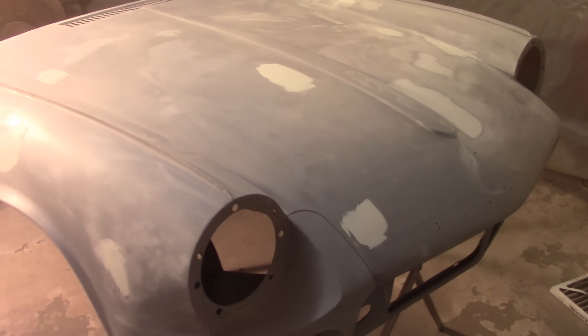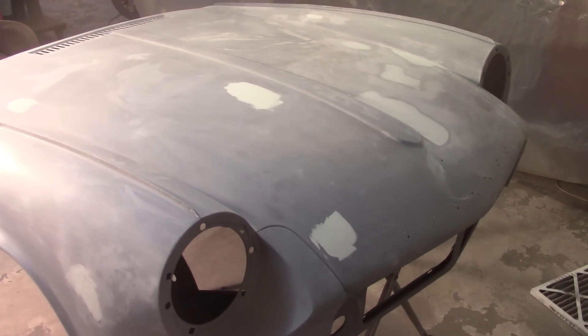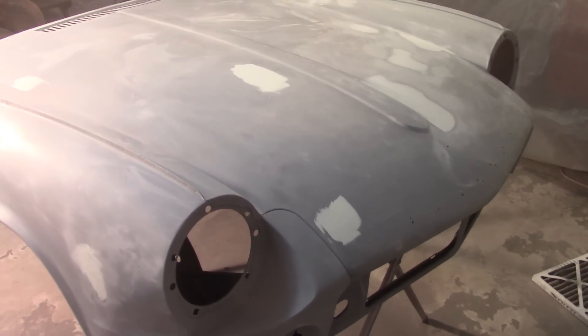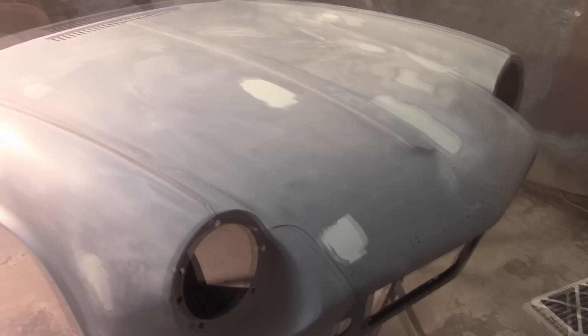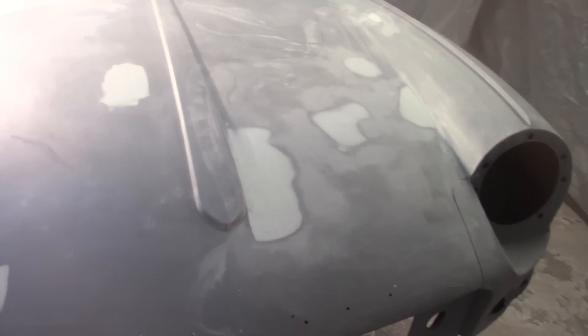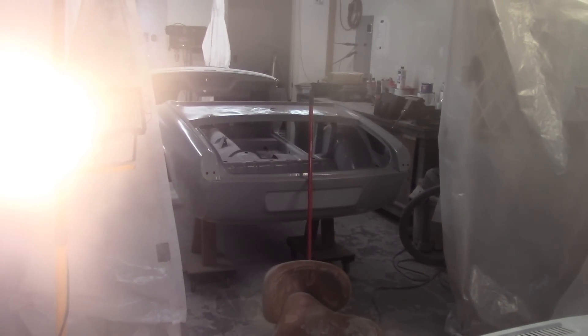Happy Monday everybody, about 3:30, back over to complete hopefully the final sanding work on the bonnet. Very very cold here — I think it got to about seven degrees for a high today. I didn't crank the heat up enough in the garage, so while I intended to get epoxy primer on the bonnet tonight, that's not going to happen. The bonnet itself is only about 64 degrees metal temperature, and the paint can sitting near the exterior wall is about 63 degrees — that stuff should be above 65 for at least 24 hours. So I've got some spots to finish sanding out and then I'll move on to start working on the body itself.